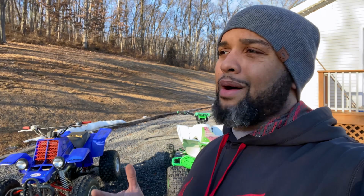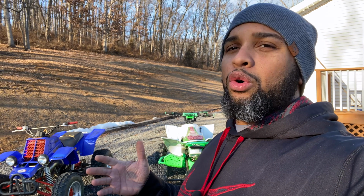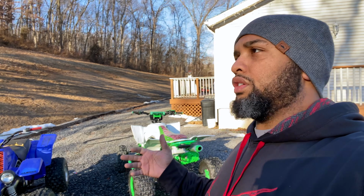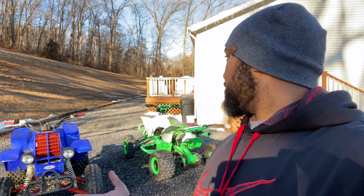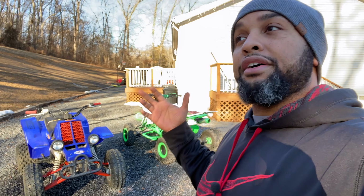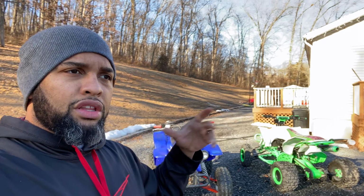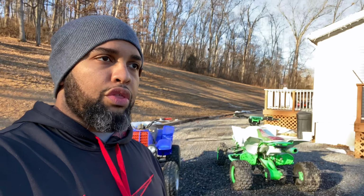I think a regular 450 comes with like 34, 35 horsepower. That WR is like 62 horsepower. I mean, this thing will move. And then I put the exhaust on it, full Barker exhaust. It's got the ProFlow adapter. Carb is jetted. It's also got a 478 big bore kit in it, high compression piston, and it's got hot cams in it. So it'll do real good. It also has the fuel mapping so that you can get all the power. It has the carb mod, so it's instant throttle response.